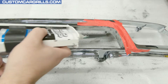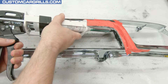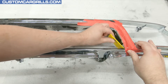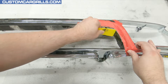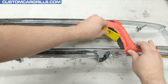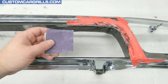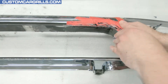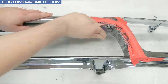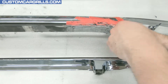Next, I taped off the left and right edge as well as the upper corners. I'm going to use a thin coat of repair material to yet again fill in any areas that were missed or uneven from previous steps. Using a cut-in-half spreader works well for evenly spreading out the material in these areas. I'll let this cure for a while and then come back with some coarse grit sandpaper — something like 100 grit works well. At this point, I'm just trying to get this edge into something that would resemble a proper looking edge as if it came from the factory this way.